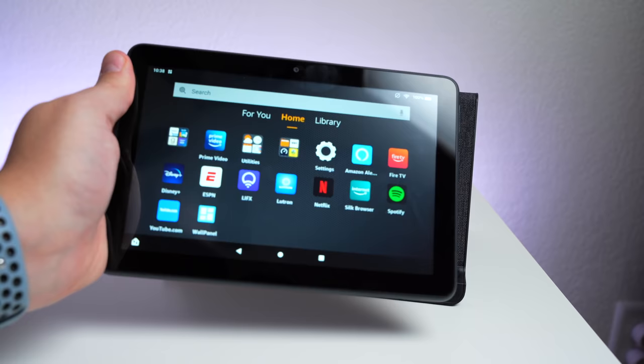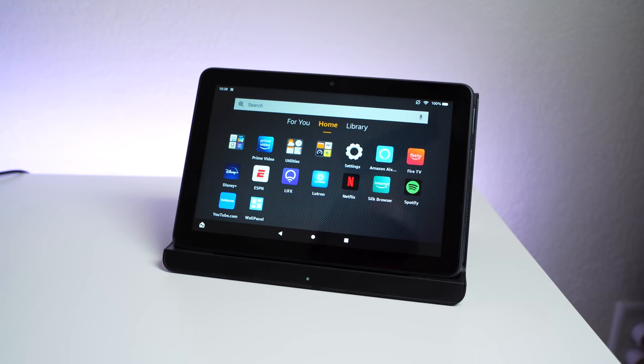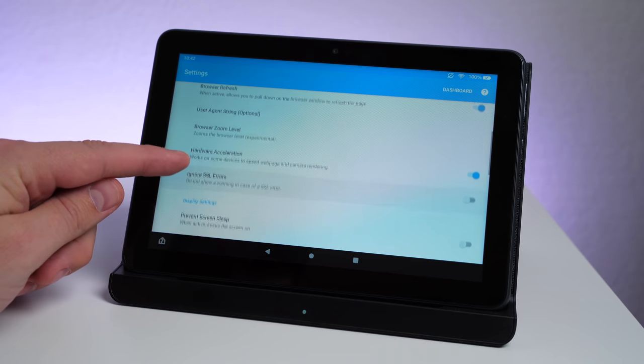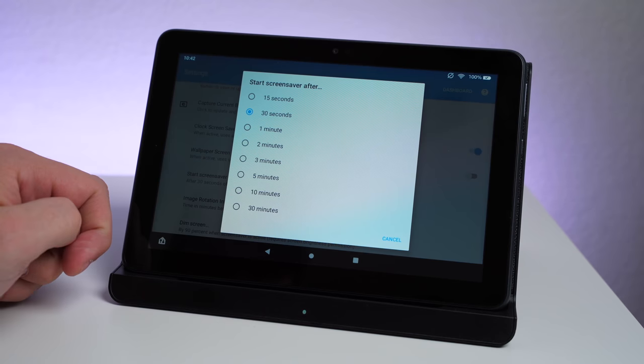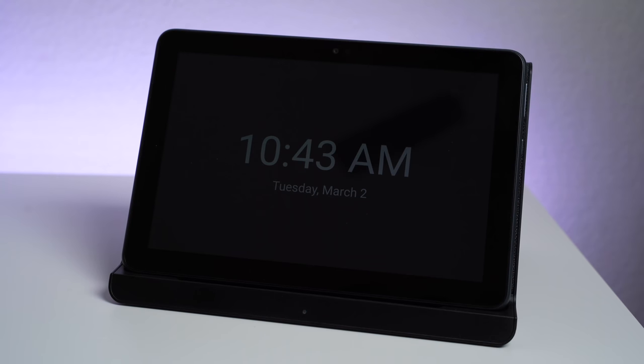Let me walk you through my setup starting with the tablet. I'm using a Fire HD 8 Plus on a wireless charging stand. Having a tablet not mounted obviously takes up more counter space, but it's easier to set up. To use Home Assistant as a dashboard on my Fire tablet, I'm using an app called Wall Panel. Originally I had to sideload it, which means you have to use a Silk browser to download the APK file to install it, but now you can just use the Amazon App Store and it's way easier. You enter in the URL of your Home Assistant dashboard. You can definitely use this for other dashboards like Sharptools or Action Tiles, so this is a free alternative to the Fully Kiosk browser that I mentioned earlier. There are some other options it gives you, like a screensaver that can dim the brightness and show a clock when you're not using it. This works well, and I just tap the screen to open up the dashboard.